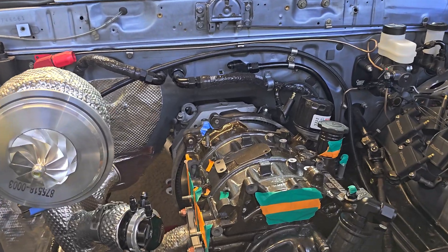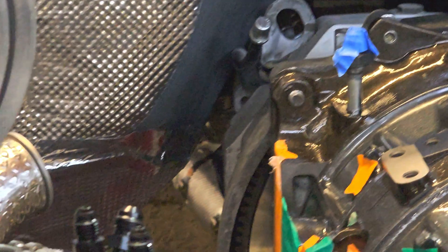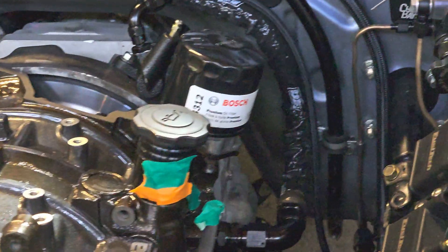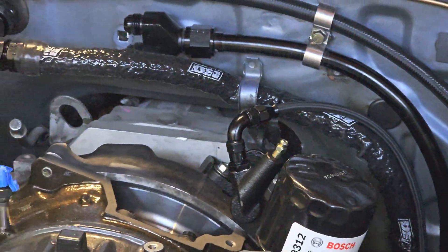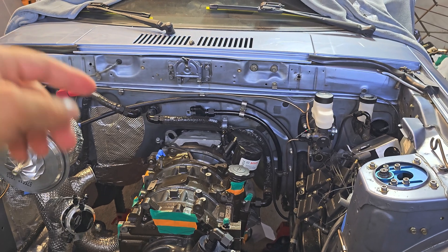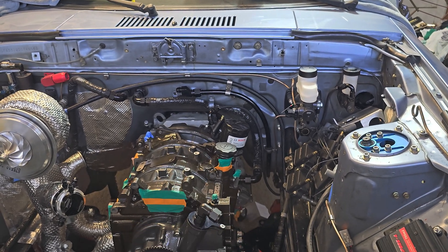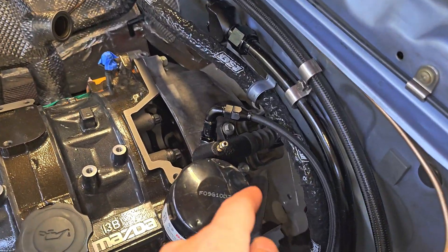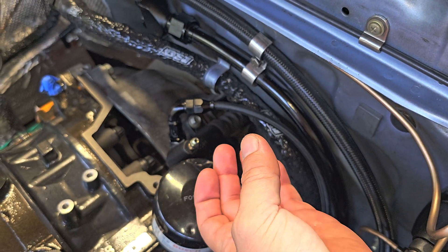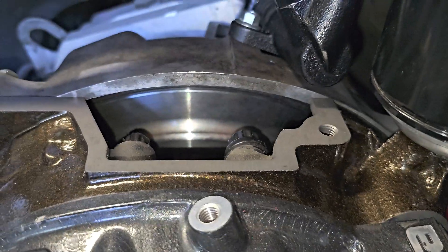We can see here — I'll zoom in for a second — there are zero clearance issues. I've got room for the vent, room to hook the transmission in the back, room back here. This configuration uses a bell housing adapter, which is a mid plate — about a one-inch-thick mid plate — that attaches the FC RX-7 bell housing and pushes the clutch throw-out bearing into the clutch using lever arm. You can see my Spec twin disc and flywheel.